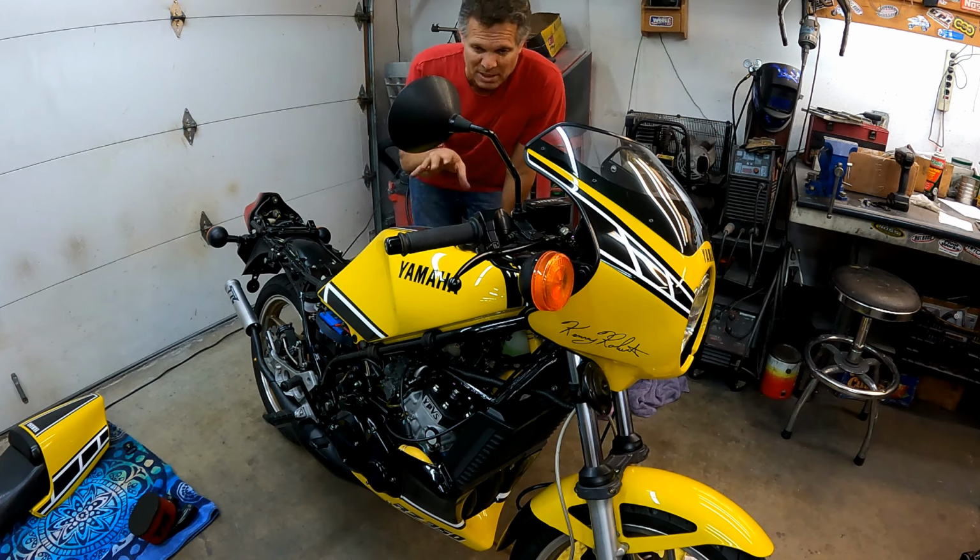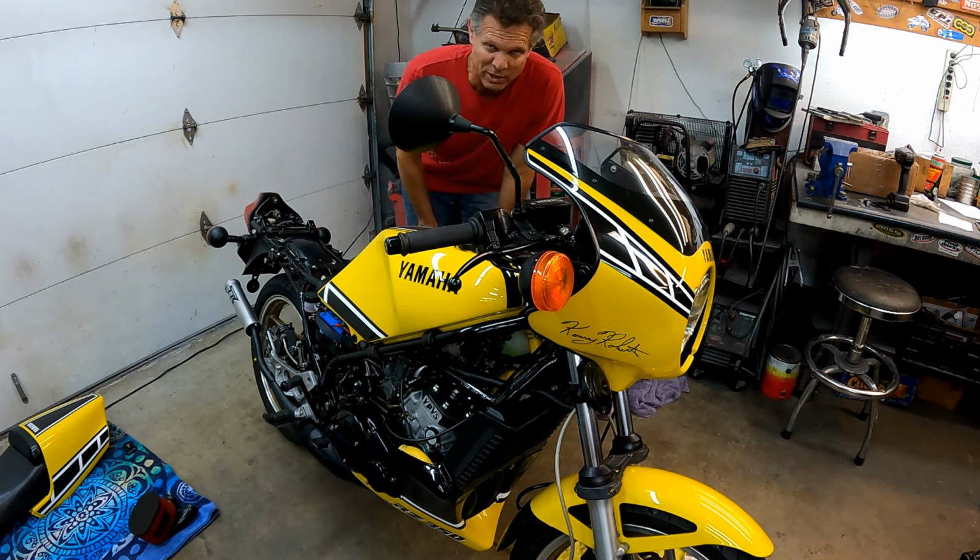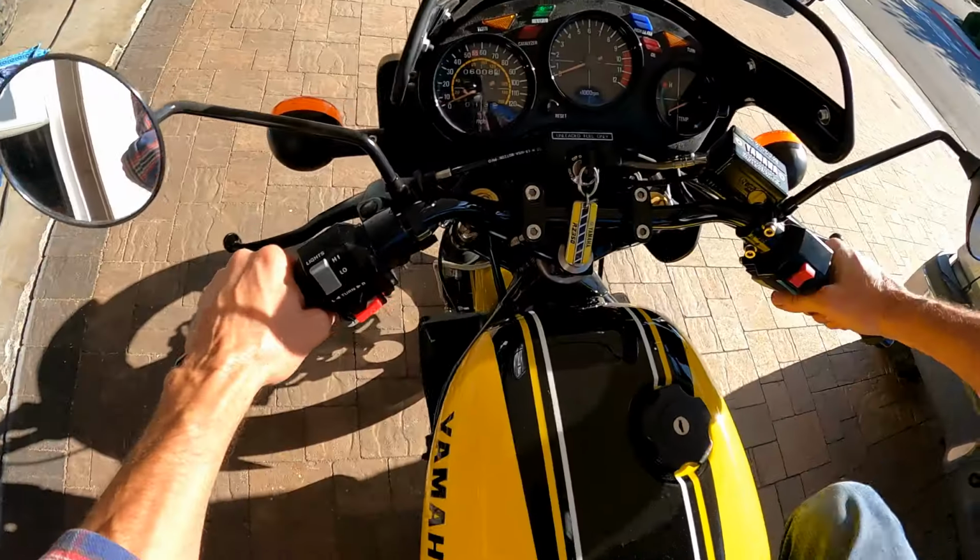You can hook it up and get it started and running and tune it to where you think it should be, and then unhook it, and it should be cold. Wait overnight and see if you can start it in the morning, or you can do it right away also, but it's better on a cold motor. Unhook the throttle cable and then try and start it. In other words, if everything's perfect, you shouldn't have to give it any gas or manipulate the throttle while starting.